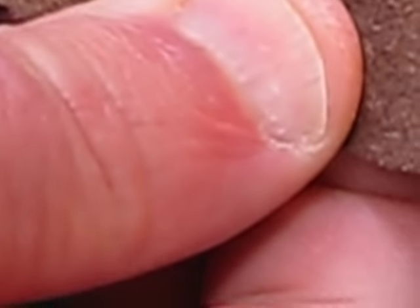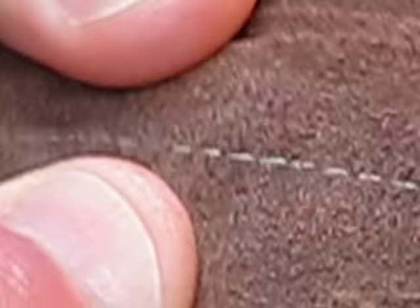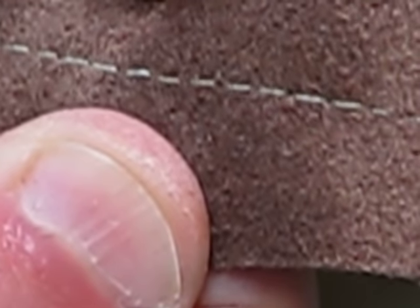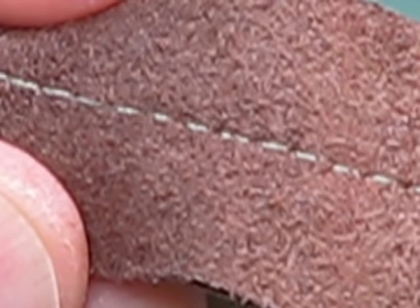The whole idea, whoops, the whole idea is to get it on camera, Scott. The whole idea is to have good stiff stitch definition on that top stitch and on that lock stitch. And you can see with your own eyes there that we definitely achieve that. Not to mention, we went through about 10 to 12 ounces of genuine cowhide leather with the wrong needle.